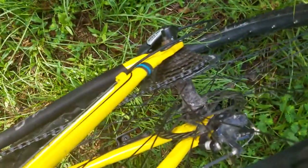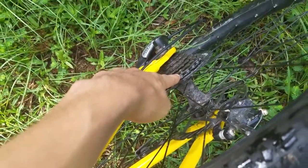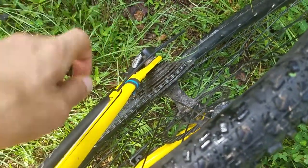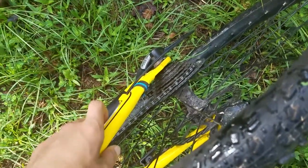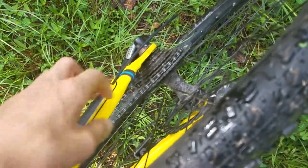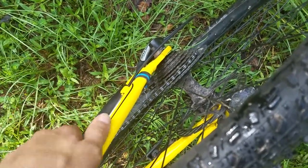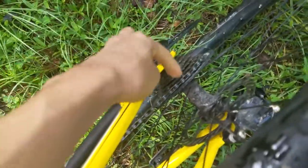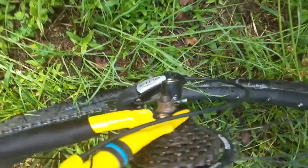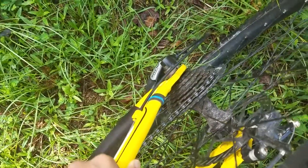The wheels on this bike are pretty good. The only problem is it uses a freewheel instead of a cassette, so I'm definitely going to change these out — I'll have a link below to the ones I think are perfect for this bike. Since it has a freewheel, even a two-foot jump was breaking the axle, so I switched over to a solid axle. Hopefully that helps, but I haven't jumped since then because I don't want to break it again.